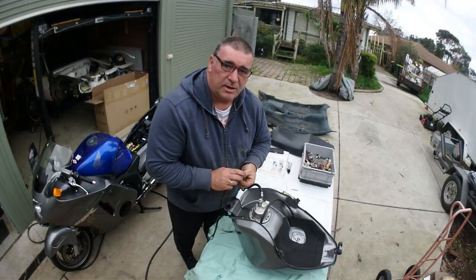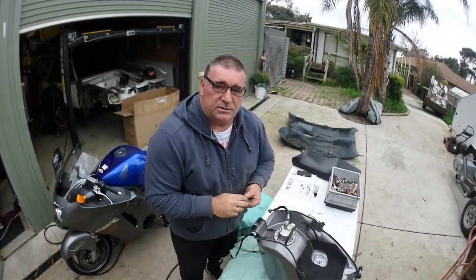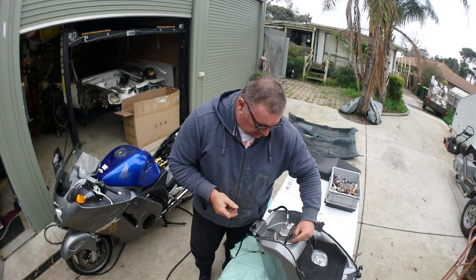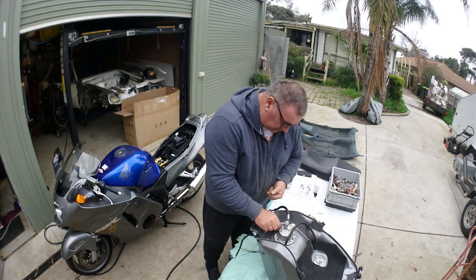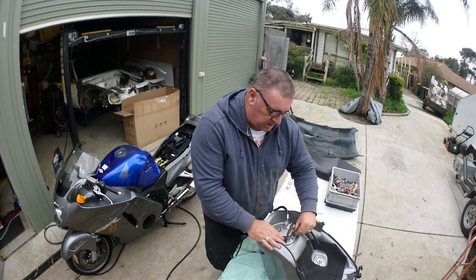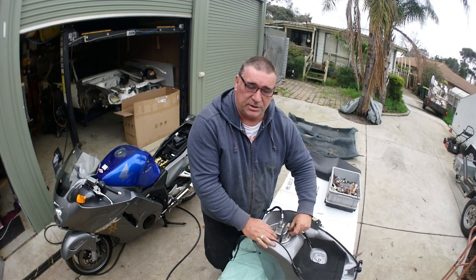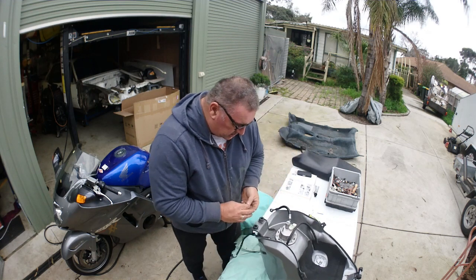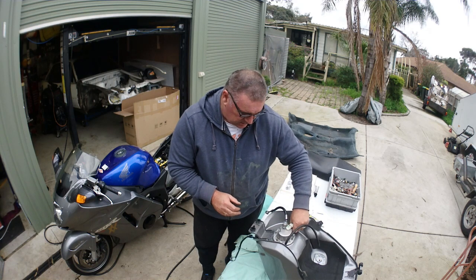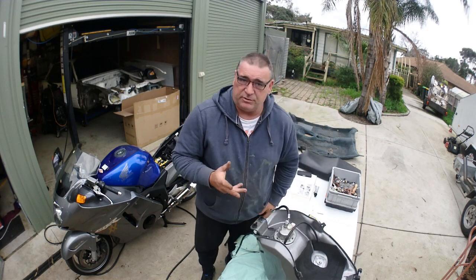If you have a motorbike and you weren't going to use it for any period of time, more than a couple of months, what would you do? I guess really it comes down to using some fuel stabilizers to stop the fuel from turning, or if you're keen enough, to empty all the fuel out. And I suppose they're the only two real ways you can do it.